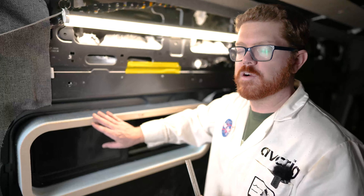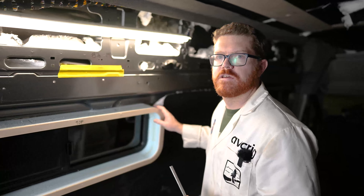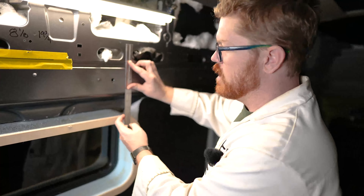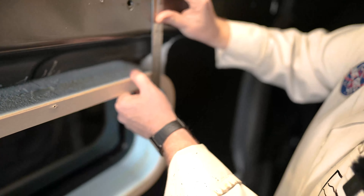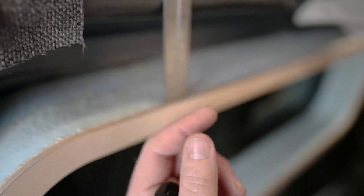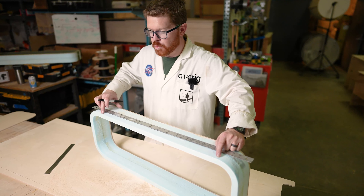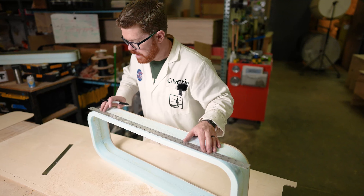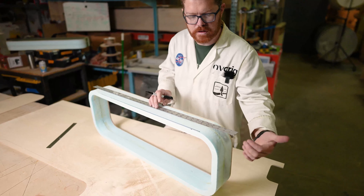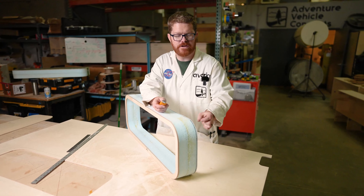I wanted to put a quick tip in here to adjust the depth of our window frame in relation to our wall of our van. The depth of the van here at the very back is a little bit shallower than it is at the front. So with this four and a quarter window frame, this plane is sitting deeper than the wall section here. By using a flat edge, we can see and visualize that difference. We're going to have a little bit of a gap, which means the wall kit is going to pull the window off the wall, and that's totally fine. But back here at the back of the van, we're actually deeper with our window frame than where our wall kit is going to want to sit. So what we want to do is cut a quarter of an inch out at the back of this window frame. I've marked at the back of the window here one quarter inch deep, and I marked a point at the front of the window that I want to keep flush. So I'm going to take my straight edge, line it up with those two marks, draw a line between the two, and I want to remove this bit of material along the back half of my window. Now with my utility knife, I'm going to cut along this edge and remove that back little quarter inch.